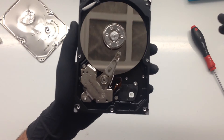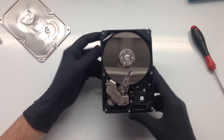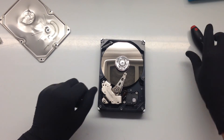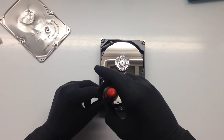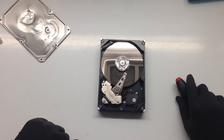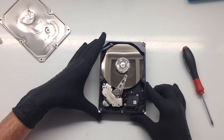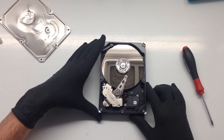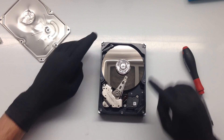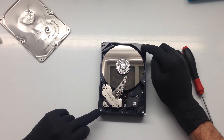If that's happened to the other platters we're going to have a hard time getting data. If you have a look at the top magnet, the screws have actually been hit so hard they've come out, but it looks like it's still got a thread on it, so I can still thread that screw into the magnet. I can't really see a lot of debris. We're going to have to replace the chassis in this drive completely — if I touch the corners there's so much warp on it.